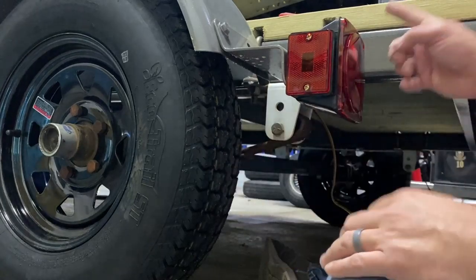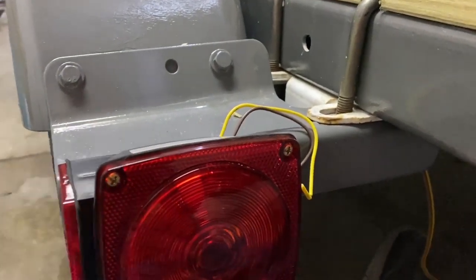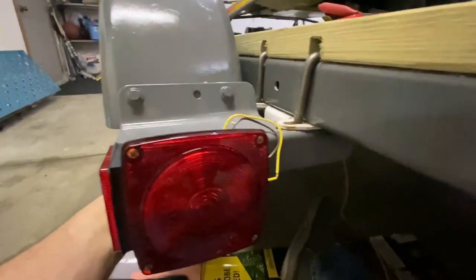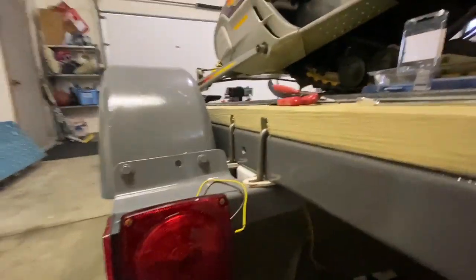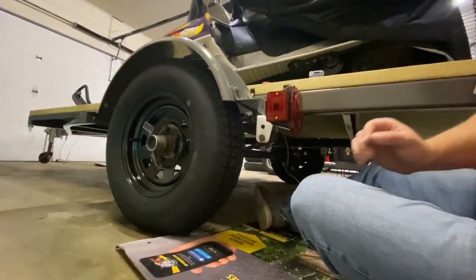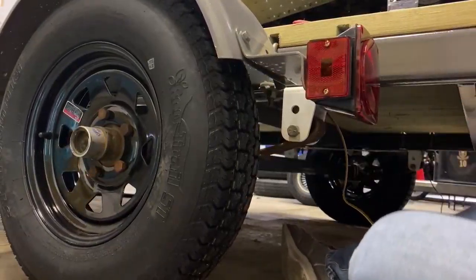If this doesn't work because this is all painted and bolted together here — if these lights don't turn on, then I've got a grounding issue. So I might have to run a small pigtail of wire from one of these bolts and run it back to the frame somewhere, because I'm not sure if this will actually ground through all that painted material. So I'll get this mounted just so I can show you the wiring.